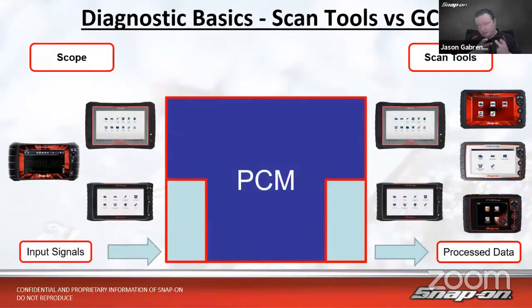Let's think about a vehicle's computer like a house — it's got a front door and a back door. Coming in the front door are all my input signals: coolant temperature sensor, knock sensor, oxygen sensor — all feeding information into the PCM. The PCM makes calculations, decides how the vehicle drives, then spits that information out the back door to the scan tool. So when you're looking at data with a scan tool, you're only seeing it after the PCM has already processed it and sent it back — all of that takes a little time.